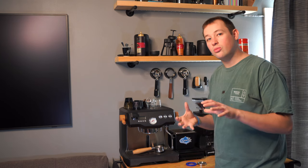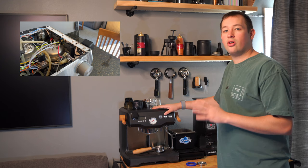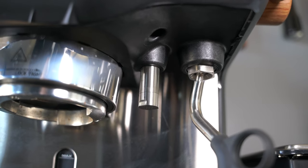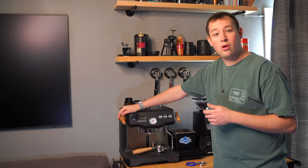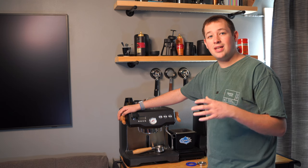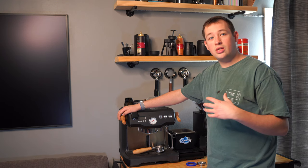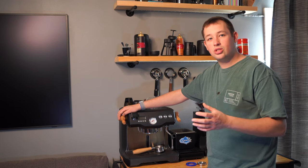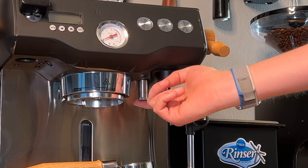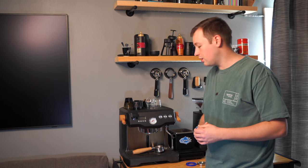The very first thing — I'm not going to go into too much detail here because I have a separate video on my channel that I will link in the description below — is this thing called the Slayer Mod. The Slayer Mod allows you to remove the hot water tap and use the hot water knob on the side of your machine to control the flow rate of your espresso, imitating a Slayer espresso machine that is well over $10,000. You simply need very little tools, take it apart, move some tubing on the inside, plug up the hot water tap, and you can control your shots. You do lose the function of your hot water tap, but all of this mod is completely reversible.